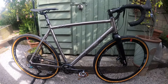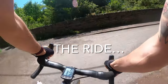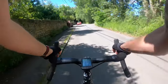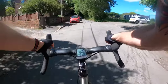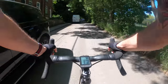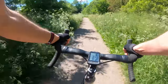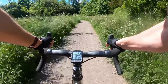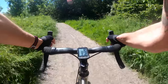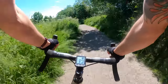Here's a final look at the Tempest — it is beautiful. About six miles in now, no squeaks or rattles so far, brakes are good, and I'm just getting used to the one-touch lever gear system, which is feeling pretty intuitive. Let's see how this 42T does on this hill. Interesting — I'd normally get up that section more easily, but then I realised at the front I've only got a 42T, whereas on my last bike I had the option of a 36T at the front. That explains why it was harder, but I still had two cogs left in reserve and I think it's about a 10% gradient anyway.